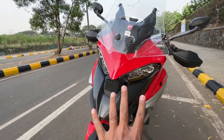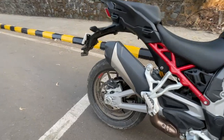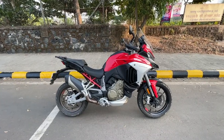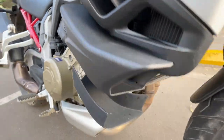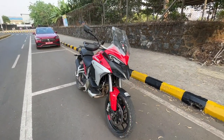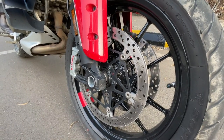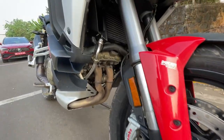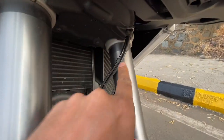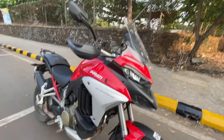This is actually the radar for the adaptive cruise control. The lights have been revised. The front tire size is a 120, 19-inch, meanwhile at the rear you get a 17-inch, 170 tire. It's actually taller now and it has got winglets - that's right, winglets on a Multistrada V4S. This is very purposeful, like an adventure sports bike. Ducati safety pack, Brembo brake calipers, dual discs at the front. It has three radiators - one, two and three. The beak has been revised as well.